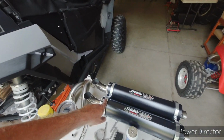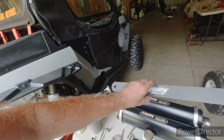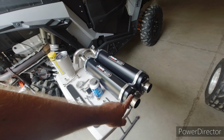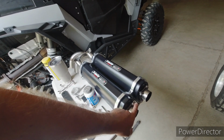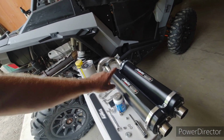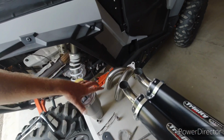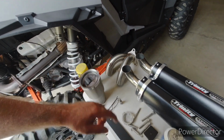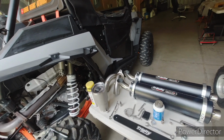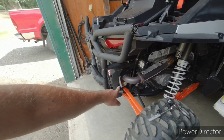I got this thing stuck together, and it's just loosely in there, so I can still adjust it back and forth. In theory, it'll be that spread right there. And then I've got these stuck on there. Something I learned already is the instructions tell you to put these at the top there and the top there. But my mounts for the other end of the spring are on the inboard sides, so it'd be there and there. So those are lined up with it. So look at yours just in case they've put those in a different spot. I'm sure the instructions are for multiple vehicles, not just one. Or might have been a production change. It's hard to say. Anyway, not that big a deal. I mean, if it was up there, you'd just take it out and move it and put it down there.